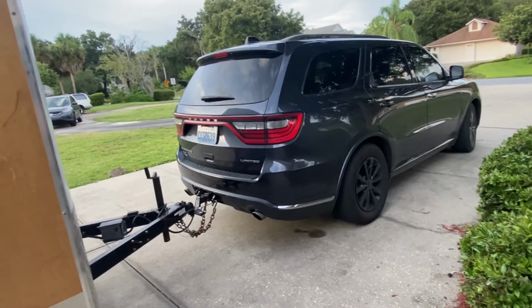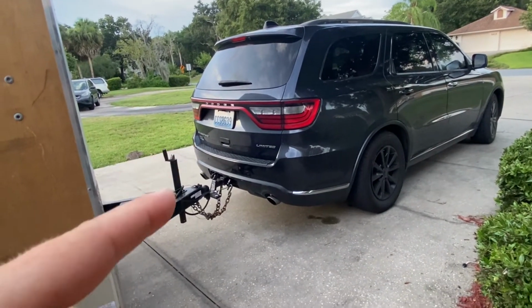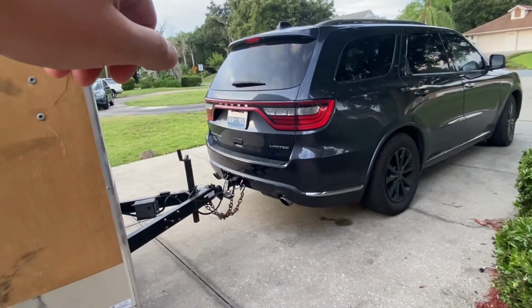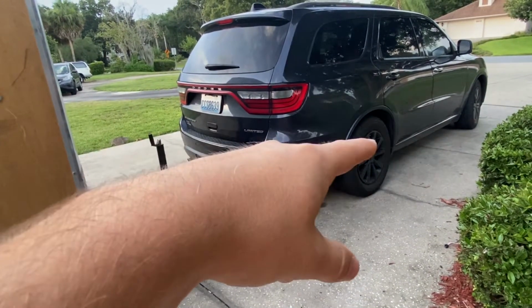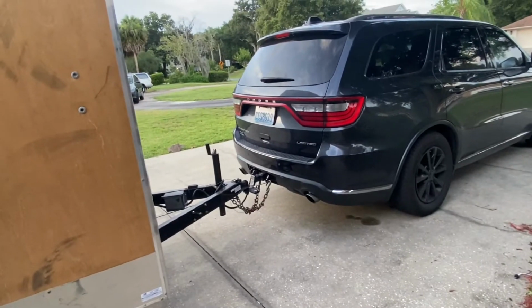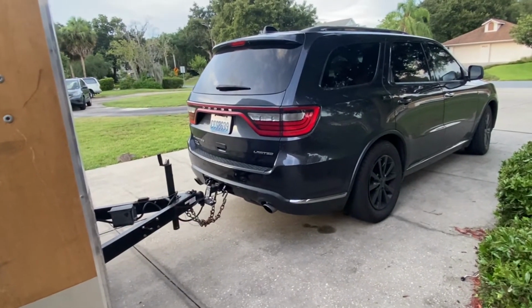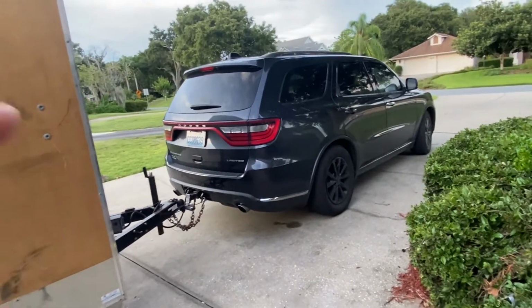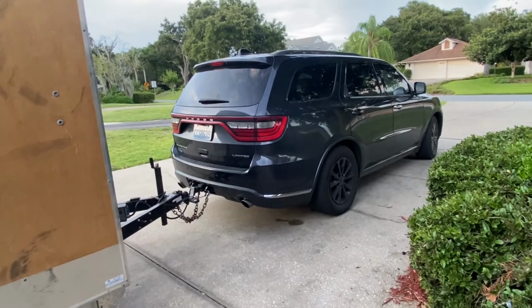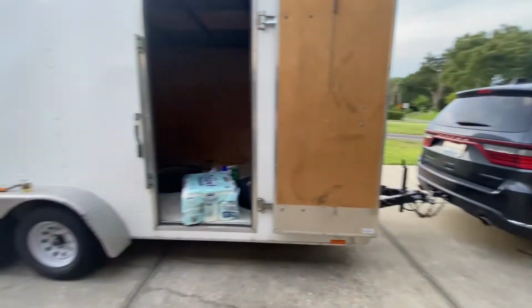I did notice in the last 400 miles of the trip, I got some extra vibration in the back. I think it was the driver's side, the other, because the boot got ripped on the passenger side. So I'm guessing it's either the bearings or the CV axle again, or not again, but the other side. Hopefully not the transmission or the differential, but this is it.